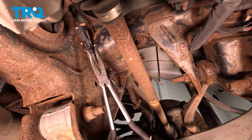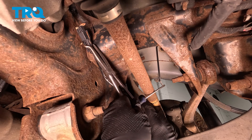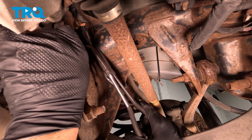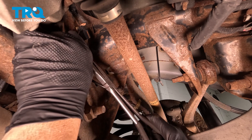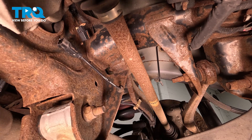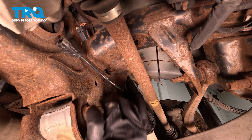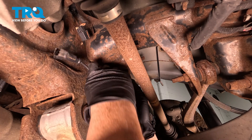With a pair of pliers, I'm going to grab the other end here and just gently wiggle this while I push in on this connector, and remove it like so. Now if you follow the wire over, we have a rubber grommet right here.